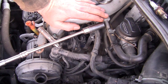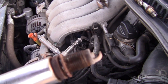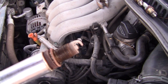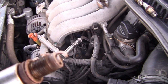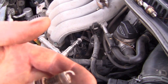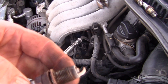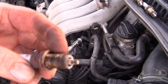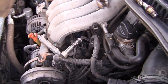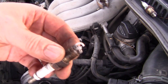Get the rest of the plugs out and take the airline back down in there to blow out any crap left from when we took the plug out. Now this is the number two plug — this is the hardest of them all to get out. Look at the gap on that sucker — that's probably about 90 thou gap right there. Did they change this one? It looks original. It's weird that the gap on that one burned off compared to number two.